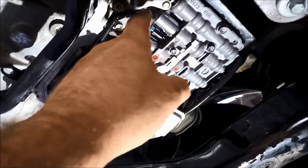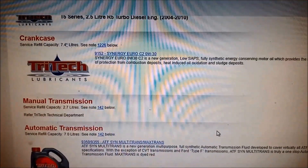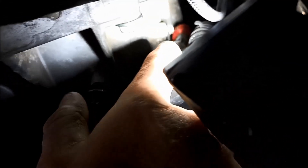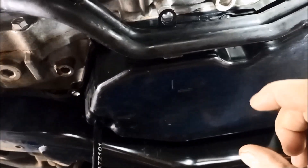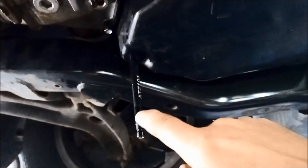With the filters back on, double-check your work — make sure you've tightened everything and all the electrical connectors are back on. We're using Tri-Tech Lubricants full synthetic Max Trans fluid. On the front of the transmission there's a little red plug — that's where you actually fill it. There's a tube that sits in there; you want the temperature at between 30 and 50 degrees and just overflowing that tube. We're going to fill it through that filler bolt because quite often you'll break that little plastic filler, and there's not much room there either.